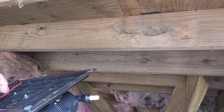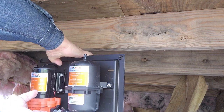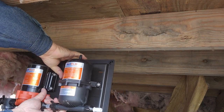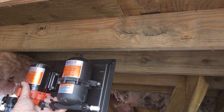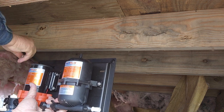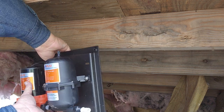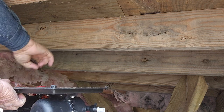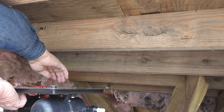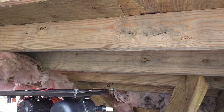You don't get any mounting hardware with this — no screws to mount it with. Regular drywall screws and regular screws won't work because the heads go right through the mounting holes. So I'm going to try these roofing screws. I'll put two up here, then cut a piece to go underneath for the bottom ones later, after I get all this done and see if it works.